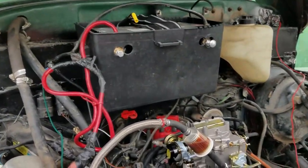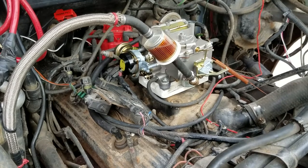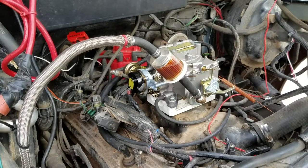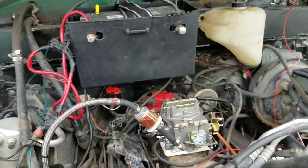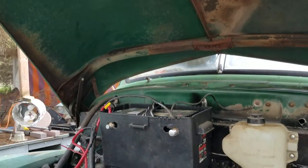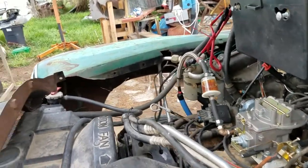This was a TBI engine and it was running like hell, so I did this carb conversion — I've done it on another vehicle and it ran perfectly after. Just the adapter plate, new HEI distributor, and a little Motorcraft 2100 two-barrel carb. Those carbs are awesome — I don't care what anyone says. There was enough room under the hood on these trucks to mount the battery up there, so I thought that's perfect — I don't have to have it sticking out anywhere else.